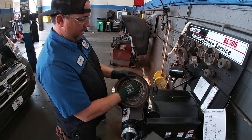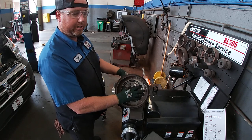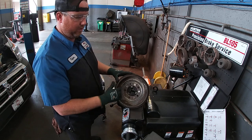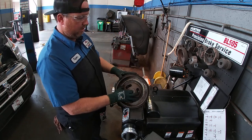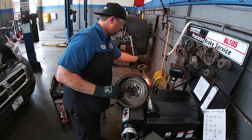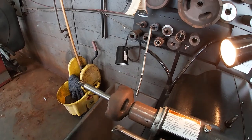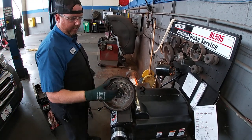From here, we need the inside adapter as the first component that goes onto the brake lathe. With discs you want as large an adapter as possible for greater clamping force and less distortion, but with drums we have to account for the cutting head, which cuts from the inside. So we need the largest hub assembly that still keeps the drum cutting head clear — making sure it won't crash into the hub. Since we're using a chuck, we don't require any centering pucks or springs, so we can mount the centering hub on directly.